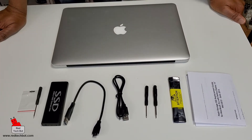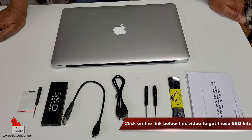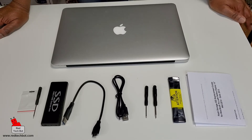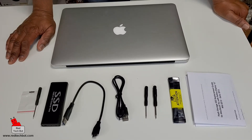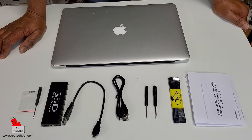As you can see, there is a yellow and black sticker on this drive, meaning you have to be very careful when handling drives like this. These things are susceptible to damage through electrostatic charge. It's winter here in Canada and the air is very dry, so I would recommend you ground yourself before you handle this equipment. If you have an ESD strap — an electrostatic discharge strap — you put it on your wrist and ground yourself so you don't risk damaging your equipment. If you don't have one, just ground yourself and make sure you don't touch the connectors.